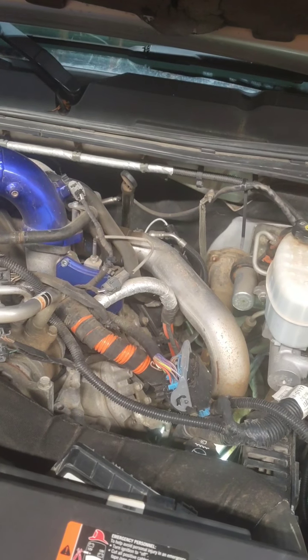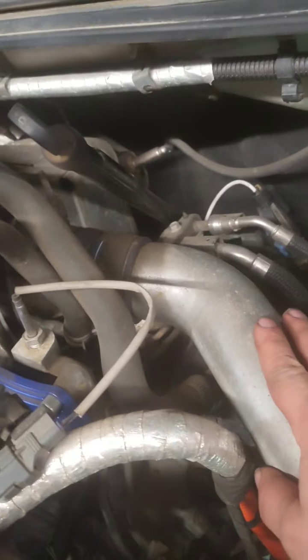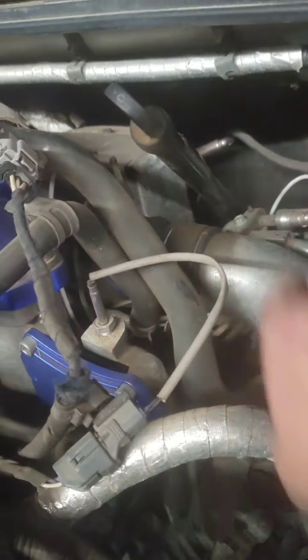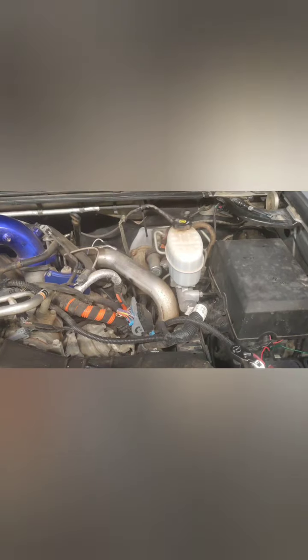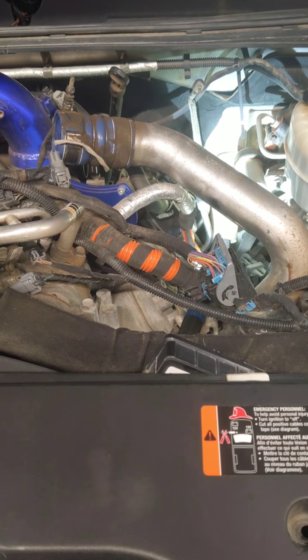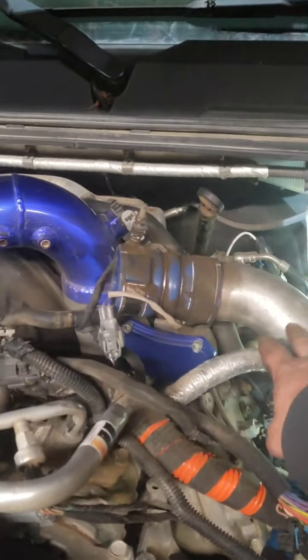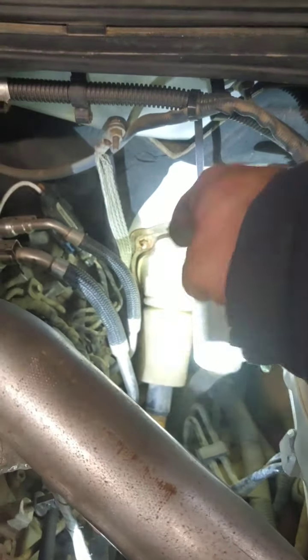I'm going to start on the driver's side right here with an 11 millimeter. I'm going to take off what you call this — the intercooler tube. There's your clamp right back here, and that'll get me access down there so I can get my arms down there. So I got this clamp loosened up now, and once I got the clamp undone for the intercooler tube I was able to pull it up — that way you're able to put your whole hand and everything down there.